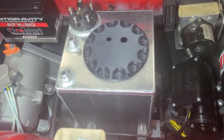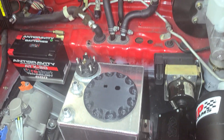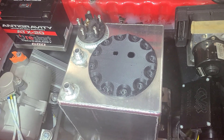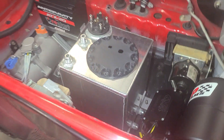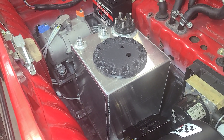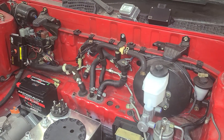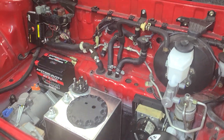I've got a fuel cell here. I still have the main fuel tank in the car, and that fuel tank will feed this one — it's essentially a surge tank, but it's two gallons. I'll have a fuel pump in here that will feed the engine, the return from that will come back to this tank, and the main gas tank and fuel pump will feed this and overflow back to the main tank.